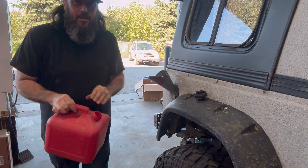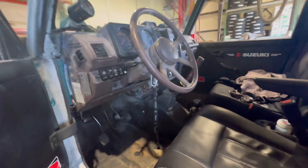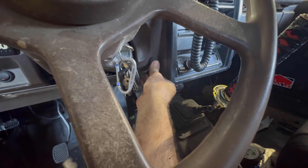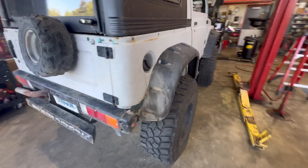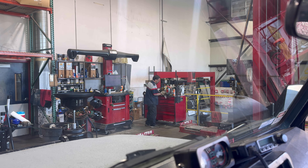I'm going to get all these wires here — you need to put a ground. I went body to frame. And your power line: this is the power wire I had for the fuel pump that was in here. I just soldered it and heat shrinked it to the little connector. Put some dielectric grease in that connector. Looks like I forgot the ground, so throw that ground up there too. I had this ground for my other fuel pump and I was going to ground the body to the frame anyway, so I just threw in another ground — why not?